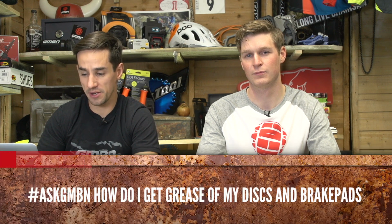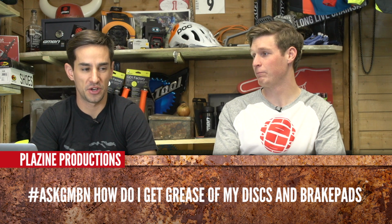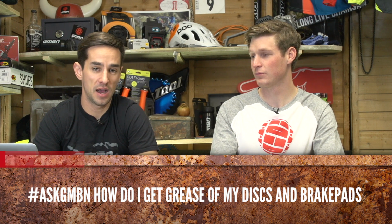Plazine Productions, how do I get grease off my discs and brake pads? That's tricky. Wipe them down on your discs. You need a bit of alcohol, sort of solvent, to get that stuff off. And then I do use a blowtorch on my brake pads to boil any oil out. Or boil a kettle if you don't have a blowtorch. But it doesn't always work, not 100% guaranteed. Correct me if I'm wrong.